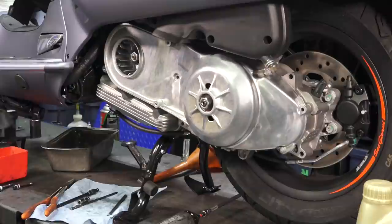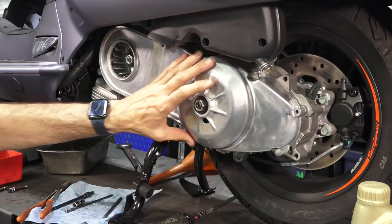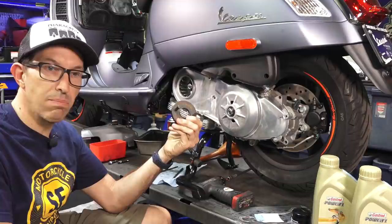There's also a small fastener — just a little tip so you don't accidentally put screws back in wrong: you can put a little X near each of these holes so you remember not to put a screw back into those holes when you get this aluminum belt cover off. There's also a ground wire on that top fastener.